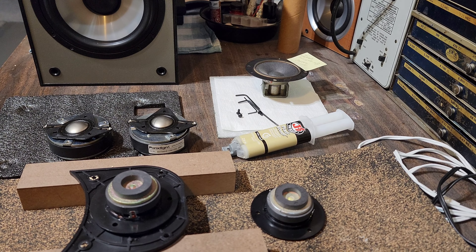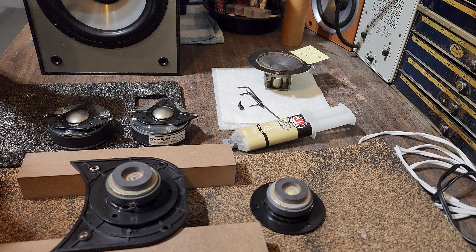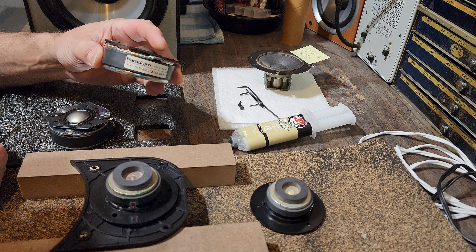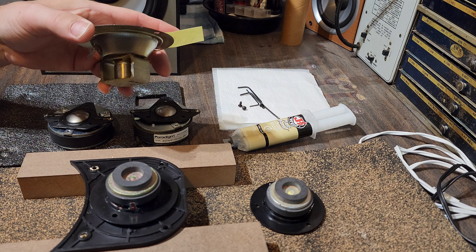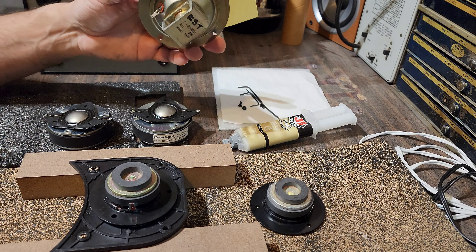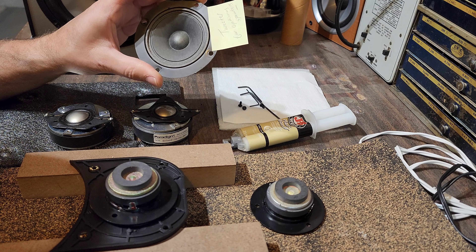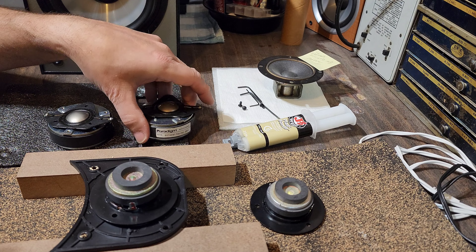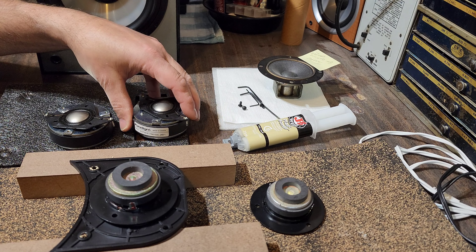These look very similar to the earlier Paradigm speakers, like the 3SE Mark IIs and so on. The actual tweeter they use, although it's a well-built tweeter — you can see just how big the magnet is — let's compare that to this tweeter from an Optimus 7, a large floor-standing speaker from Realistic, which resembles the Sansui 3005 or some early JBLs. That's a little alnico magnet on that one, whereas this is a large ceramic magnet, which you find in most modern speakers.